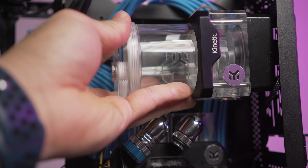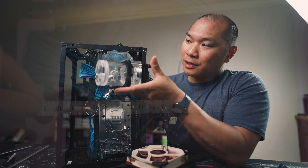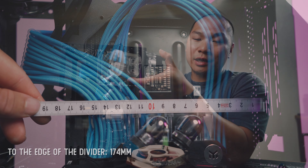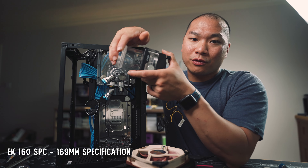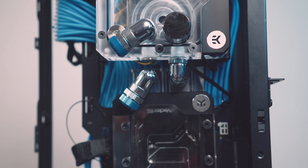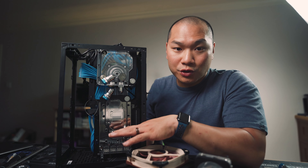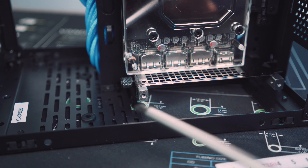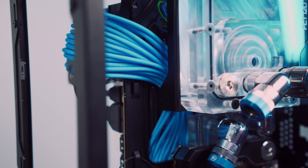This one is the 120 millimeter long tube, and I think that's ideal for flexibility in this case. With the right unit, you could probably get a 160mm long cylinder in the case — something like the EK 160 SPC would probably fit within this space. But you do lose flexibility for the tubing coming out of the top. Continuing on the case, we arrive at 330, and that's the GPU length you'll have all the way to the top if you shift the support bars all the way down. The true amount of length available is contingent on how your pump is positioned and connected if you're using a standalone pump res unit — that is the absolute max.